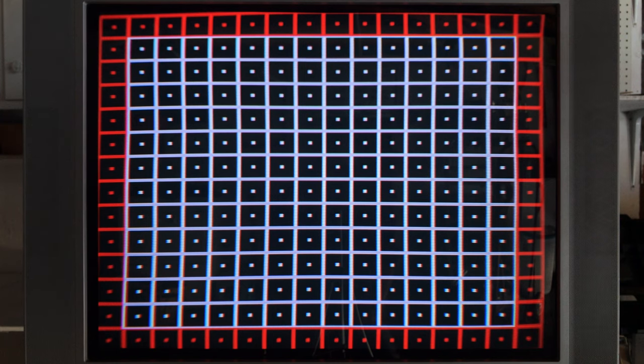I am not a grid fetishist. I don't like to pull up grids and stare at them for fun; it doesn't fill me with satisfaction to have a perfect grid. What I want is a good-looking game, and the gameplay on it looks fine. You've got to look to notice any kind of imperfections. This is a good example of a TV that you get — it doesn't have a perfect grid but it's good enough. I have gotten rid of CRTs because watching movies and playing games the imperfections were distracting. I did correct this TV, and when I got it I almost didn't keep it because the geometry was worse before I corrected it. It had some convergence issues — it still does; it had pretty bad convergence.